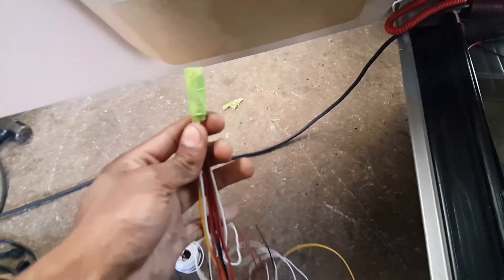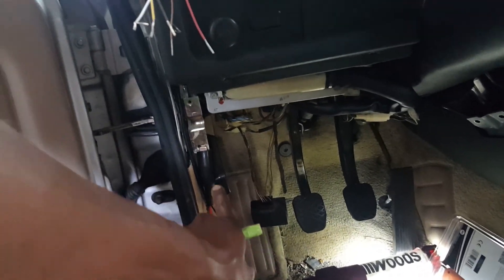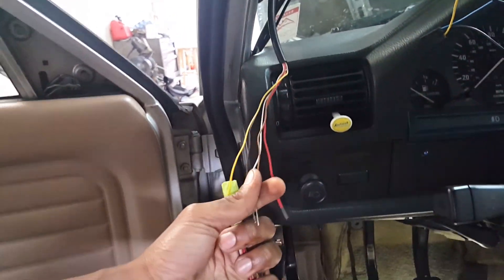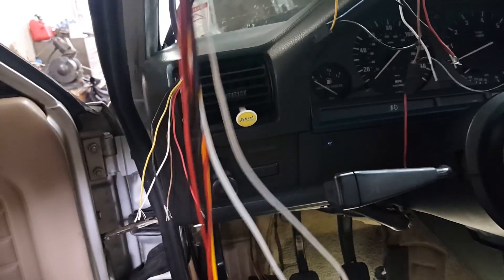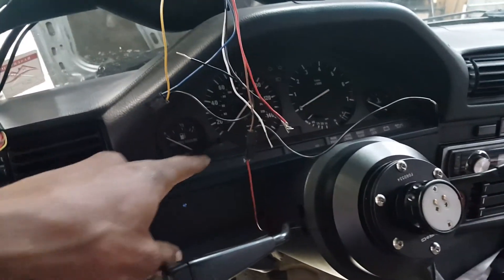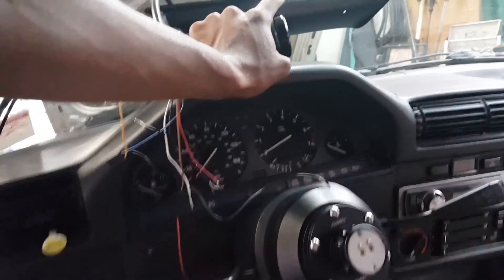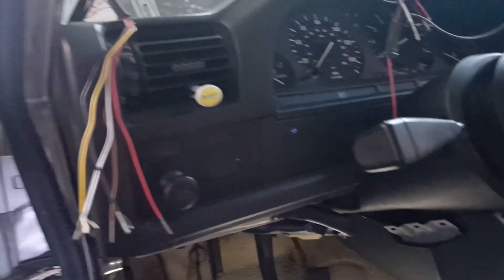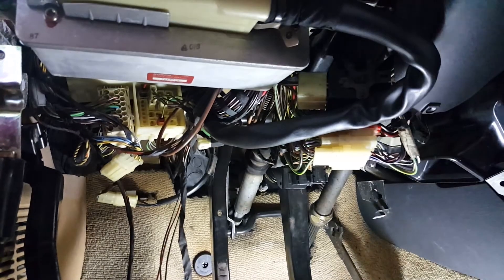I got all the wires sorted out. I'll fish them from underneath and go up through here to meet up with these wires, then solder them together — and also solder the wires from here together. Then I have them leading down: one wire will go to the tachometer because this is a boost gauge and also a shift light, and the other wires will be fed down underneath here where I'll tap into the red ignition wire.